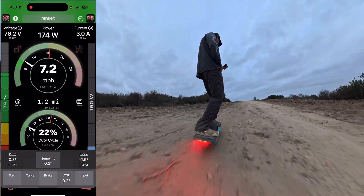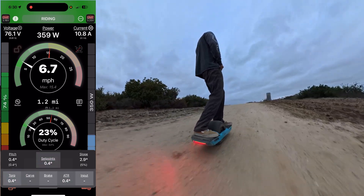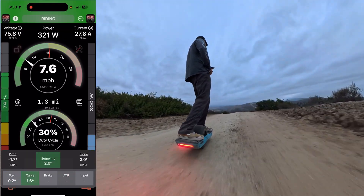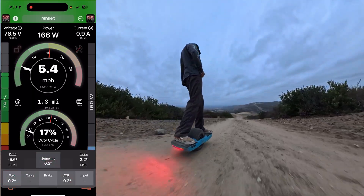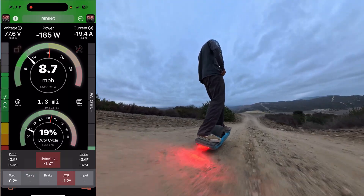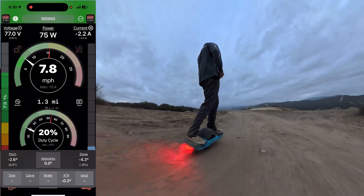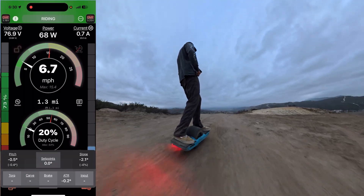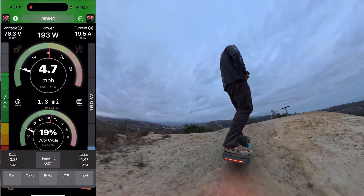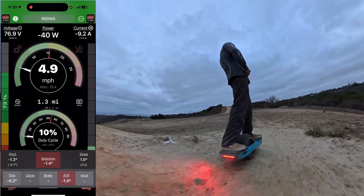You don't have to do that — you can also enable showing the setpoints by long-pressing duty cycle, for example in Float Control. Now you can see which setpoint is in effect at which moment, so you can see if things are as expected. If you don't want to look at the screen while riding, you can screen record it — make sure you enable audio in the screen recording. That way you can document when that weird behavior is occurring and quickly figure out if it's an IMU issue or just a weird setting in your Float package. That should make it a lot easier to troubleshoot.